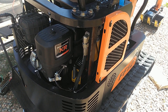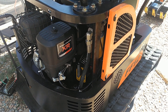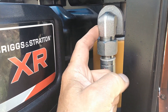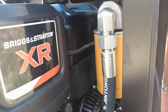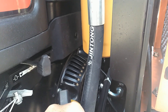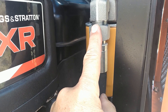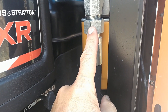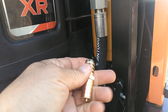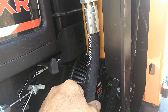Planning on installing the hydraulic oil cooler radiator, I decided I'm going to use the return line of the hydraulic oil filter that goes back to the tank. This will be the lowest pressure line. So what I'm going to do is slice into this line and then put a barb with hose clamps on it, since this is such a low pressure line.